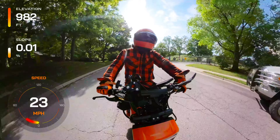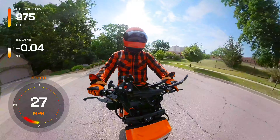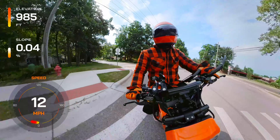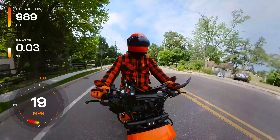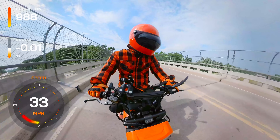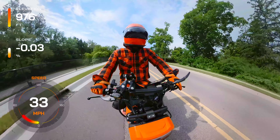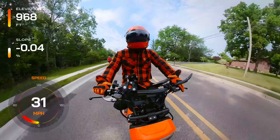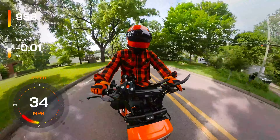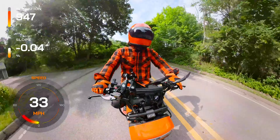This is our second official test ride with the 72-volt Ego Mini Bike. All of the panels are back together, all the wiring is secured, and we installed the lighting. We hit up our buddy Ryan Goodyear to get some updated power settings and made some tweaks to the controller, so hopefully this will show us our true top speed. We did fix the wobbling that was happening in the last video. If I told you guys what the issue was, you probably wouldn't believe me — basically one of the tire spoons was inside of the rim or inside of the tire. We didn't catch it when we put on the street tires, and that's what was causing the issues. Kind of crazy — the chances of that actually happening are so minimal, but it happened to us, and good thing we figured it out.